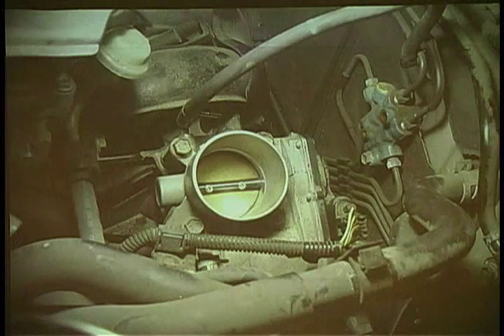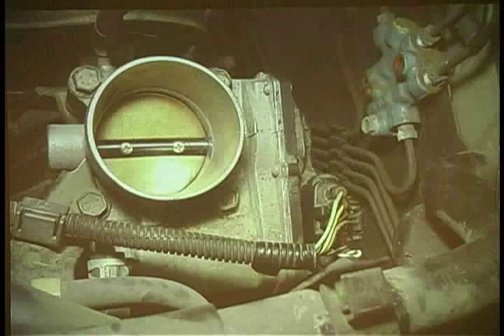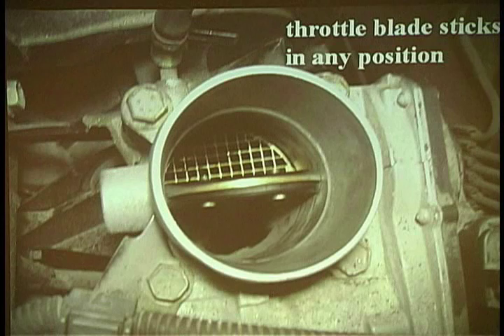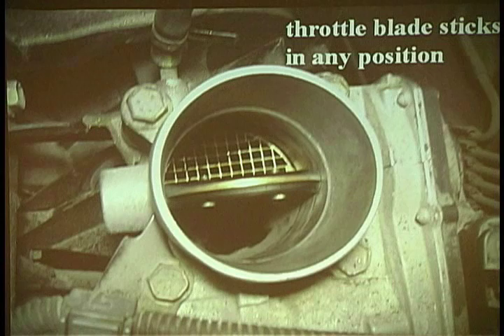So I get the ductwork out of the way. I get to the throttle body, and there's two things I like to do. I like to make sure they're clean, and I push on them. So I get a close look. I'm going to do a little bit of back probing myself a little bit later. I have pushed that throttle blade wide open, and my fingers aren't there, and that throttle blade is stuck in a wide open position.